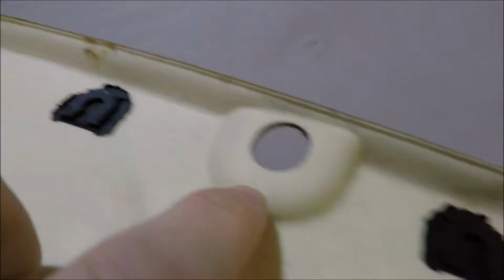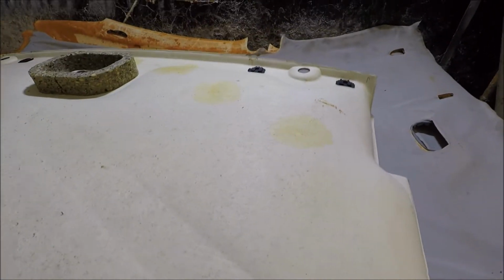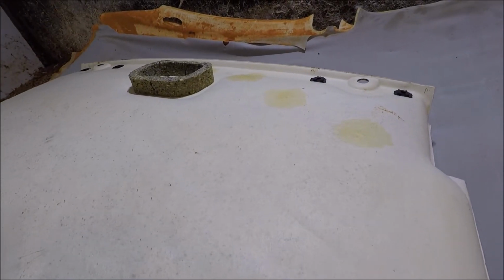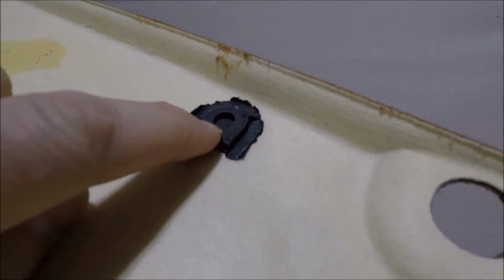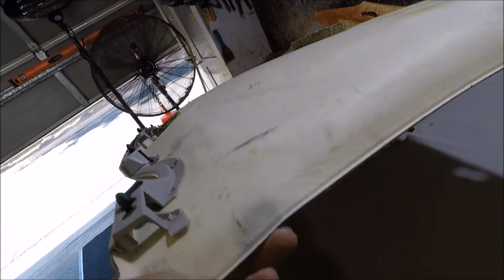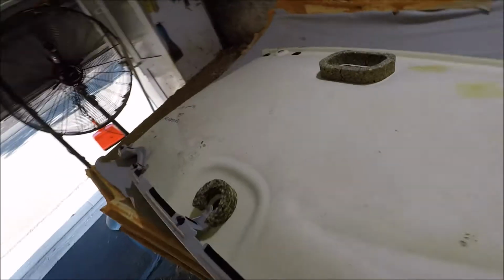And then at the back, at the rear here, there are these ones here, another set of 5. However, with those ones, all you're doing is pushing the headliner board towards the back and then back away again, so that would unhook those rear plugs at the back, and then the headliner board safely comes down. You can take it away from the side plastic trim molds, and that's it.